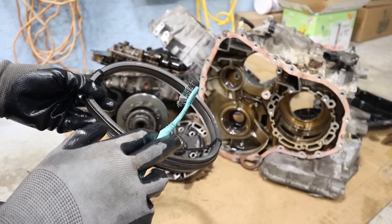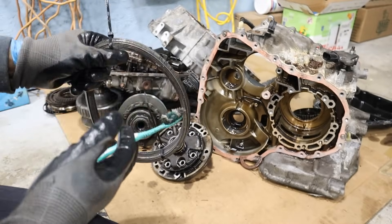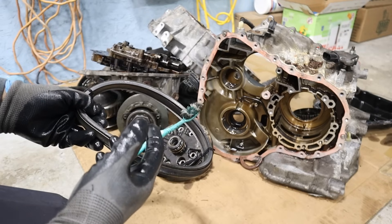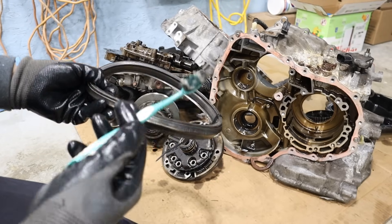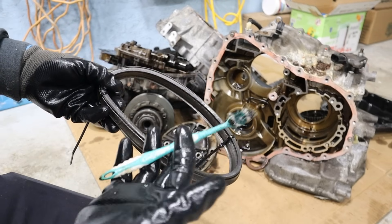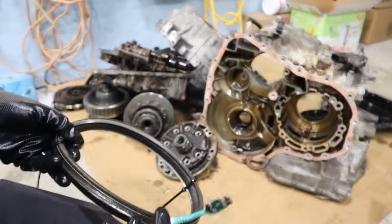And that's a look inside of the K313 continuously variable transmission from Toyota. In my opinion, the owner likely got this stuck in snow, and combining that with the clear lack of transmission fluid changes, it allowed all the particles to go inside and clog other things up. Toyota's been making this transmission for a while and they've generally been reliable — they do have quite a robust design. Drop a comment down below if you've got one of these transmissions in your car and let me know how it drives. Make sure you subscribe if you want to see more videos just like this one.